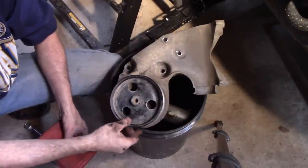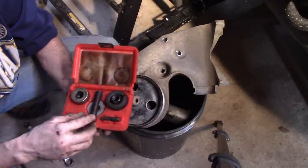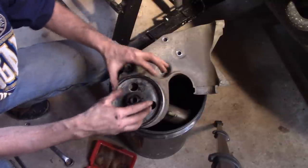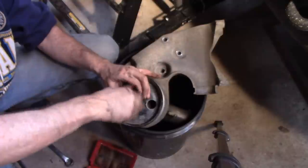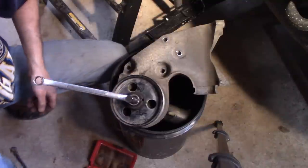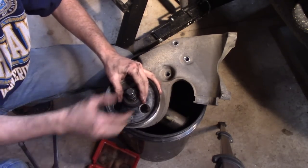I set the bracket in a bucket to give me a working surface and catch any drips still coming out of the pump. Pulleys on these are pressed on, so you will need a power steering pulley removal and installation tool — most parts stores do rent these, or you can buy it and return it when done. Take the collar and put it in the slot on the pump pulley, put the pusher tip in the threaded shaft and thread it in. The shaft on mine is 5/8" and the nut on the bottom is 13/16". Pull it off — it just pops right off.